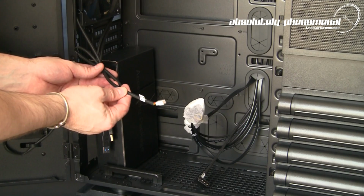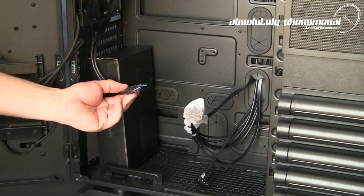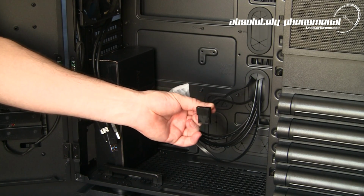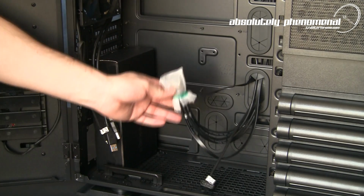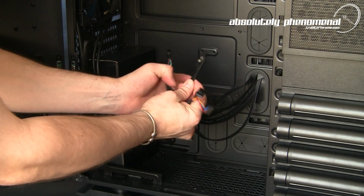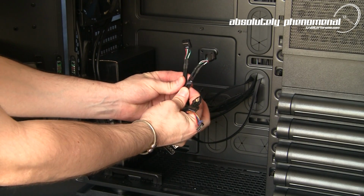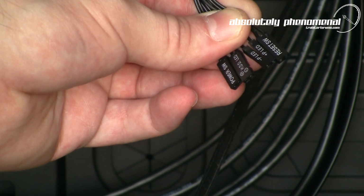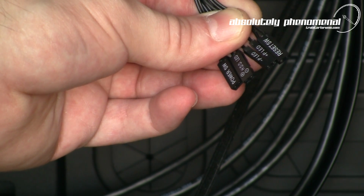Inside the case, you also have wiring for a 3-pin fan connector, 2 USB 3.0 pass-through cables, a 4-pin Molex connector for the ColorShift fans, and an additional bundle of motherboard connections which contain HD audio connections, a SATA connector for the top panel's eSATA port, 2 USB 2.0 internal header connections, as well as connections for the reset switch, power LED, hard disk drive activity LED, and power switch.